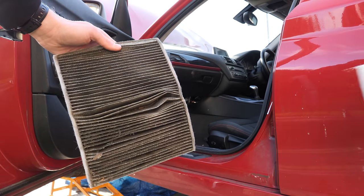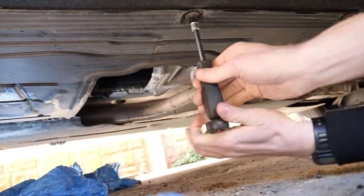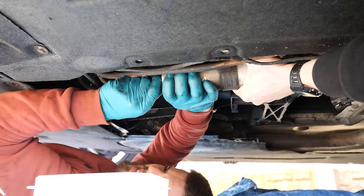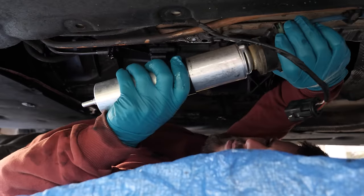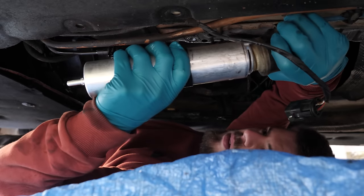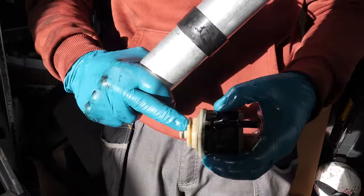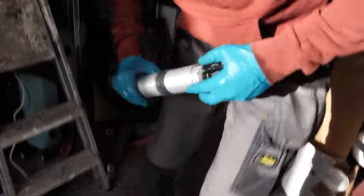So this is the old fuel filter, which is black, and the new one's so white I can't even expose for it. About here we realised this new fuel filter is just not going onto the car — the orange plastic bit was too thick for the metal hole. Tom luckily saved the day; he managed to file just the end of the orange nib off so it squeezed into the fuel filter and the O-rings still sealed perfectly. Fuel filter is officially on.